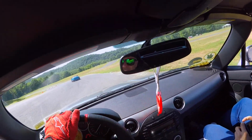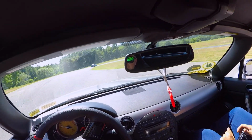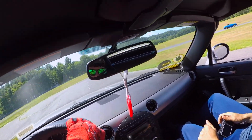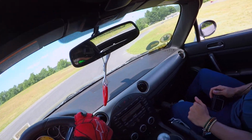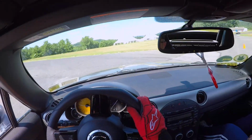So when I set my cars up, I like a lot of rotation easily on gas and brakes. So I do less camber. I try to do less camber in the rear than the front, at worst case match them. But no, I mean the car, I like the turn and the steering effort's very light on it. The nose points in nicely.